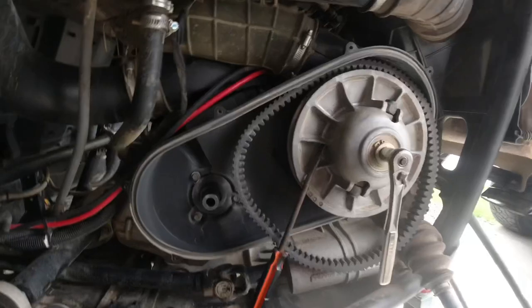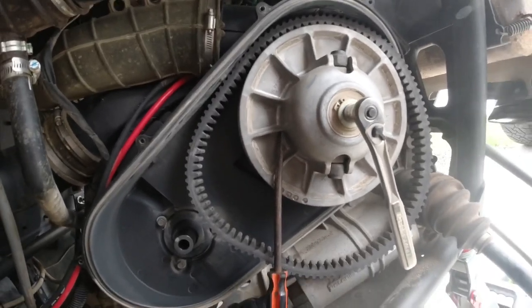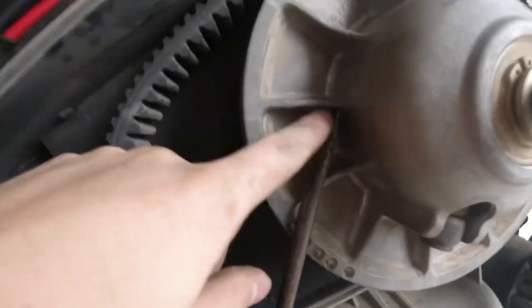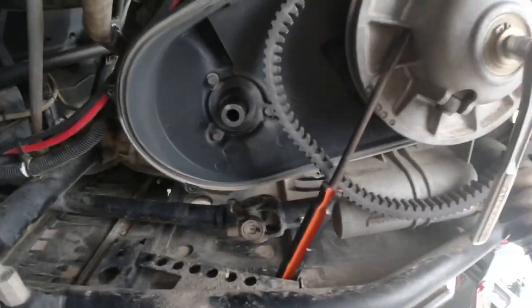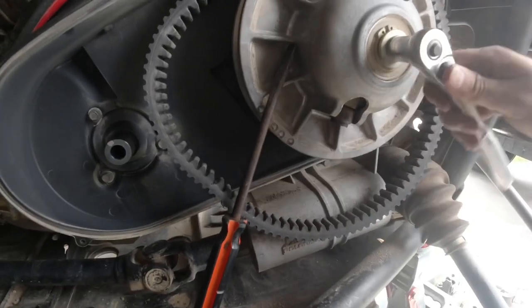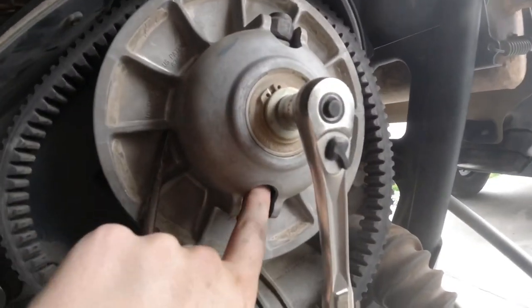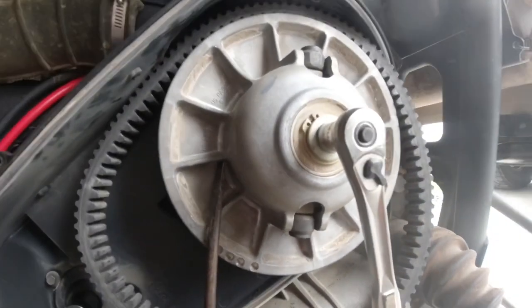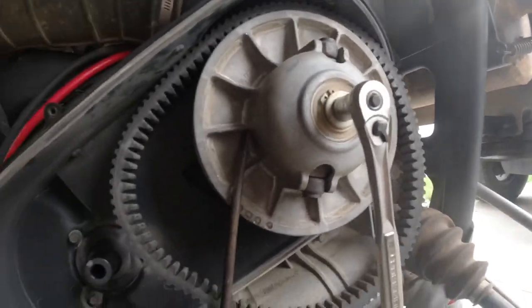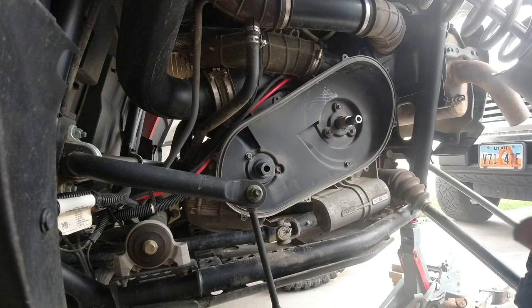The secondary ended up being a lot tougher to get loose than I was anticipating. I wasn't able to effectively hold it — I tried putting the belt on it to hold on. What I found to work best: take a screwdriver, lodge it up under one of these splines here, and then up against the bottom of the frame, which allowed me to pull against it and force right into the screwdriver. I found it a lot more sturdy that way and was able to get it out. It was pretty tough but didn't break anything — just had to pull really hard. There's the secondary; get that cleaned up and see if it's in good shape.